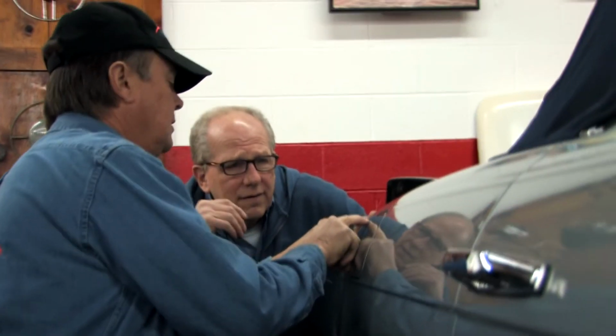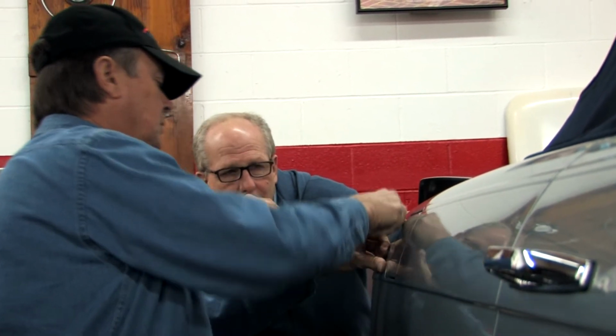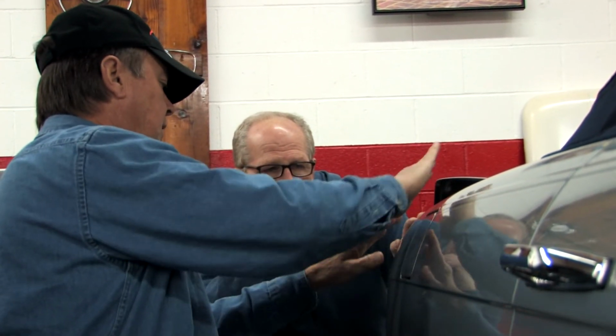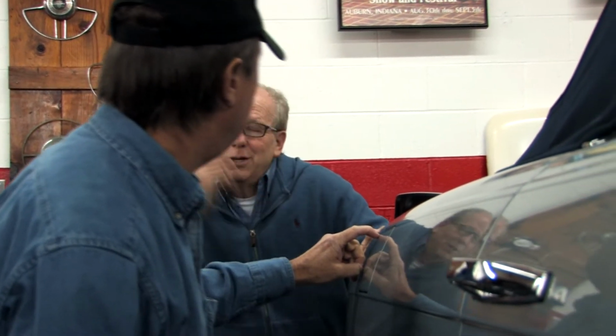Interesting. You can actually see the paint. Right at the end of the dark color, there's a little raised lip. That's where they pulled the tape off, and your paint went down and settled on that edge. It made a little shelf. I can see it all the way down here, and they did it on the bottom side too. You can still see where surface tension curled the edge up. But looking straight in here, you can see the middle doesn't have any of that clear. So they just left it on there and painted over it.